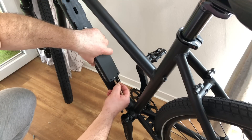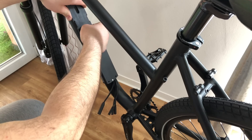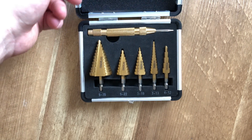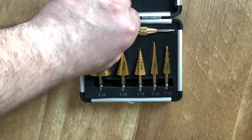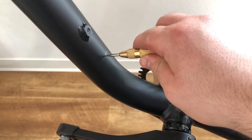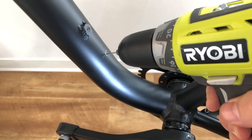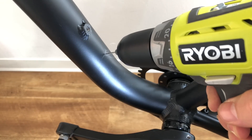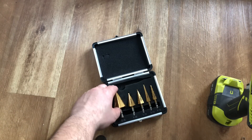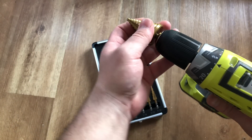I'm mounting the battery base temporarily because I need to mark where I need to drill the hole. My plan is to drill a 23mm hole so I can feed the cables inside the tube. I purposely chose this frame because it's more of a heavy-duty one — it's thicker and it can handle the stress. So if you're planning to do something similar, make sure your frame can handle it. I will show the full process and I will also use my 3D printer to print a small gasket with flexible filament to cover the hole.